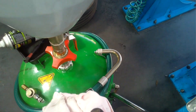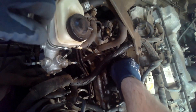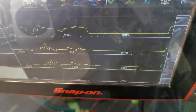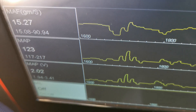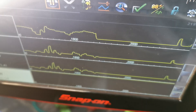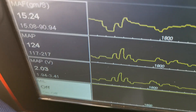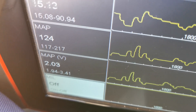After that I spoke to the customer and got the go ahead for a new sensor. After the new sensor was installed it was time to bring it for a road test and confirm we had rectified the issue. As you can see the reading is at 2 volts and we are getting a response when we throttle on and off — we can see a voltage change and a reading change.